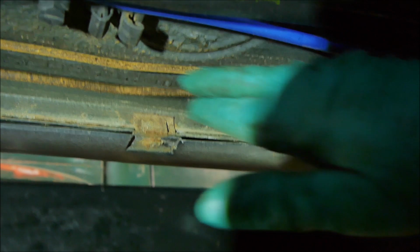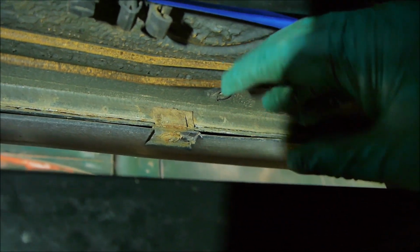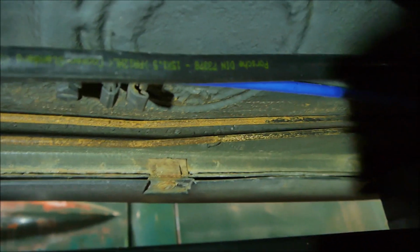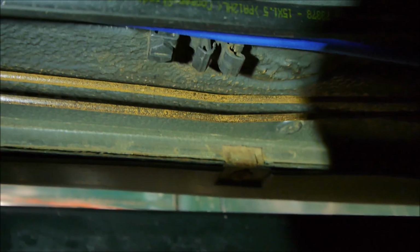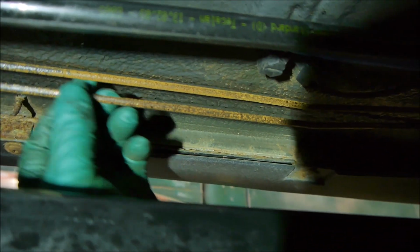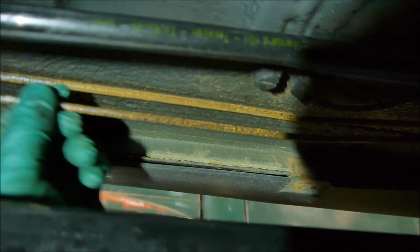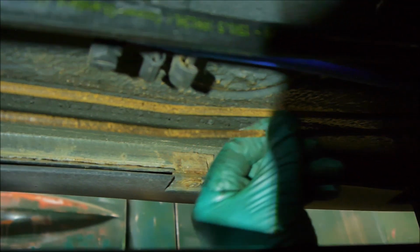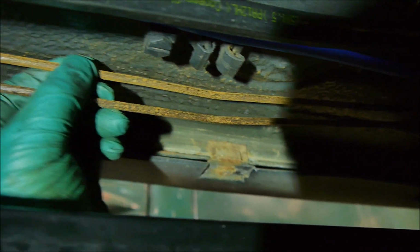So these are the brake pipes here. A little bit of focus issue going on. They do look bright orange and a bit angry, but they were properly flared up, and as I say, rust will expand 10 times the original metal, and it will look angry. The thickness of these pipes, as I've said before, is 0.7, so it's pretty thick. You're going to have to feel some sort of wasting down to get to the point of fatiguing. So now I have rubbed these down, and I've rubbed my fingers down them, and I do not feel it wasting away at all.